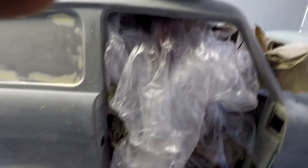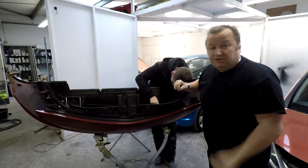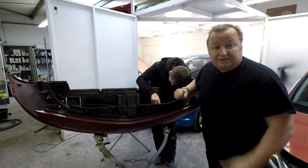Here's the bumpers — the bumper covers are off the Fiat. I'm just going to have to give these a bit of a sand down. I've come down to give Jimmy a hand, and we're just going to finish preparing these. The main part of it's been rubbed down and sprayed — it's just all the edges he wants done, so I'm going to be doing that for him. And the Trotter van, as you can see, is still being used as a skip. I've done all the repair work I needed to around here now, this is basically ready on this side. I've sanded that down to 240 grit — this is nearly ready for primer now. It just wants one final sand all over. So while Jimmy's doing this, I'm going to get them bumper covers out, give them a sand down, put you on time lapse, and you can just hang around while we're doing this.